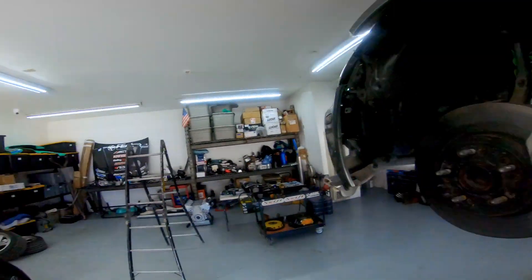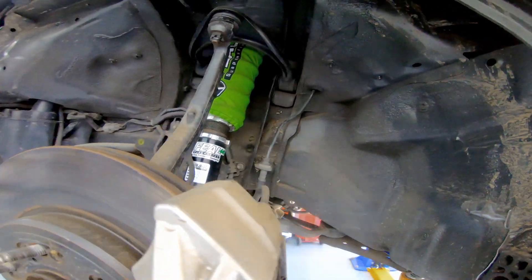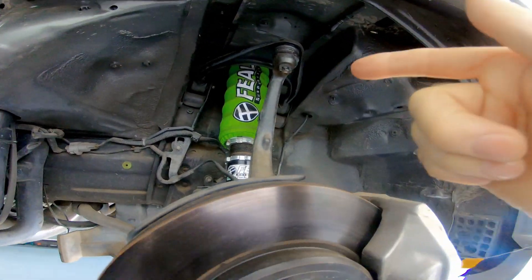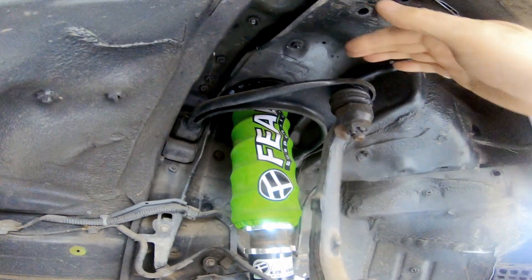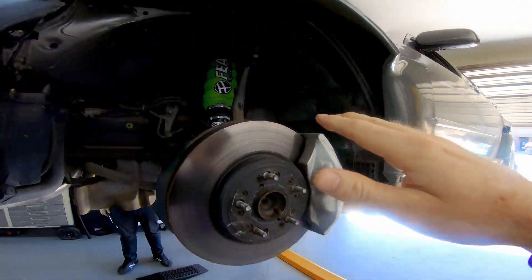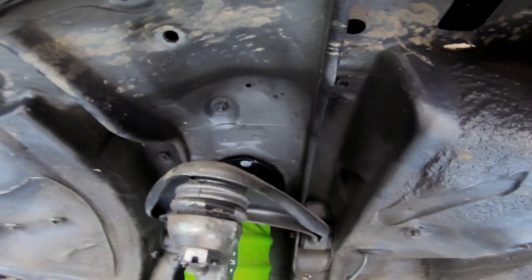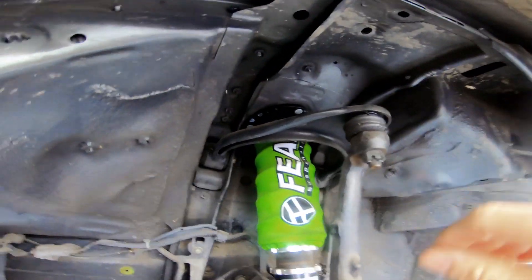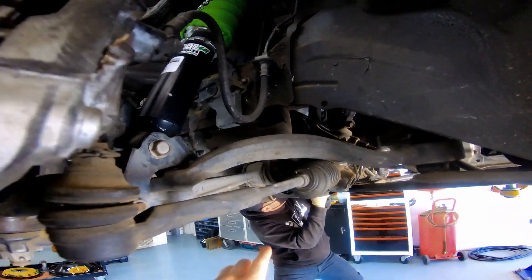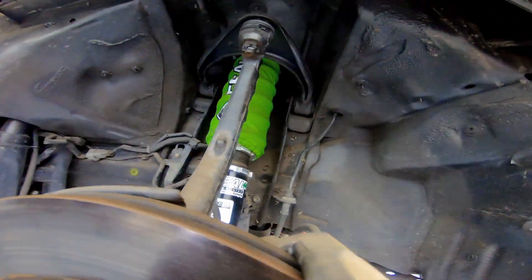Before we rip into this thing, let's check out the stock suspension. This is a pretty traditional suspension — it's a rear steer, similar to a 240, but what's cool about the IS is it has an upper control arm and a lower control arm. It's not a McPherson strut. The biggest flaw on these ISs is after you lower them, the upper control arm gets really close to the chassis. At full droop you can see how little space there is, and under compression there's barely any suspension travel left. There's even an indent where this part is actually hitting. There's also no camber adjustability in the upper control arm, just a little at the lower, and everything's on rubber so it's not really sturdy.